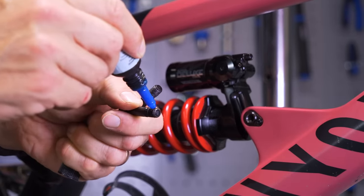Before setting up the sag, you need to make sure the shock is fairly neutral. If you have adjustable compression and rebound on your coil shock, take them out of the equation — unwind them counterclockwise. You've got a rebound dial here, so counterclockwise all the way, so nothing else is affecting your sag. Then carefully push the bottom-out bumper up against the seal, sit on the bike, give it a bit of a bounce — same method as for an air shock. Once you're settled, carefully get off the bike, and look at the shaft to see how much sag you have.